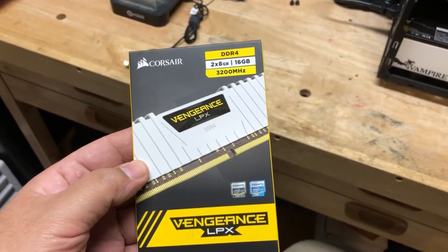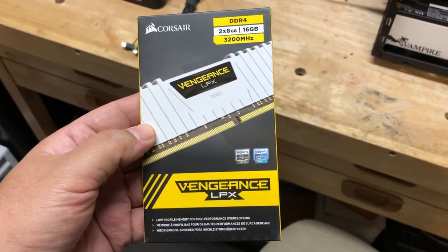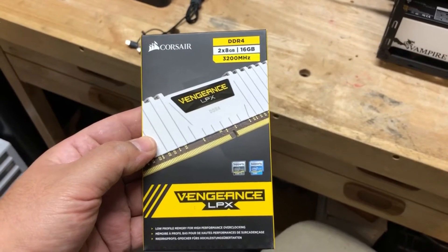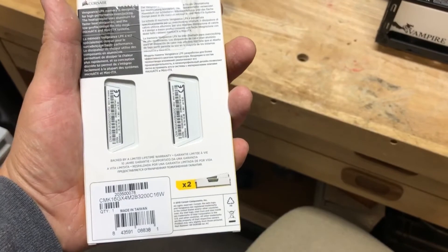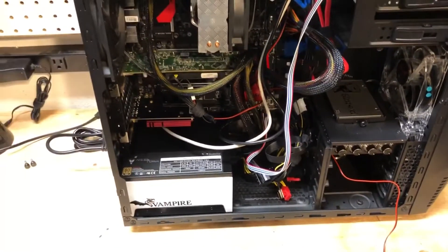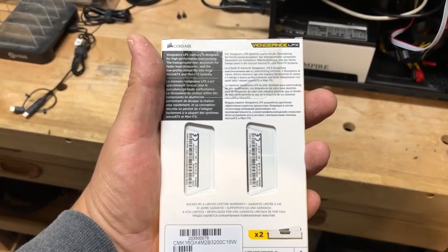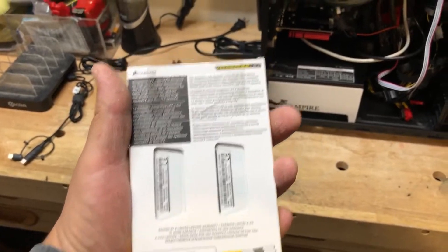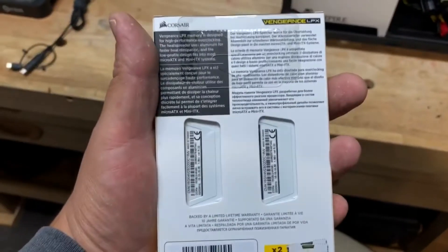These are a little slower than the other ones I had. I emailed the seller from the previous memory I got and they gave me a full refund. I ended up buying from another seller in my local area, so I'm hoping these will be the ones to finally bring this project to an end, because it's been a lot more of a struggle than I ever thought building this PC. Hopefully this will solve the problems and we'll get the BIOS on screen, because the other RAM was giving me no picture at all. I tried troubleshooting — pulled the RAM out and turning it on without RAM gave me the same result, so I'm thinking the RAM was bad.